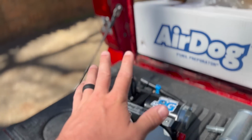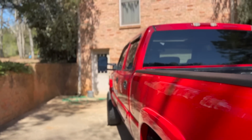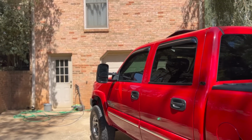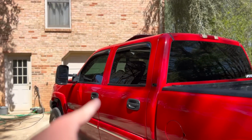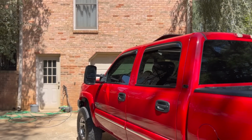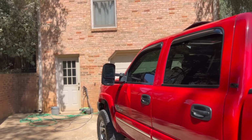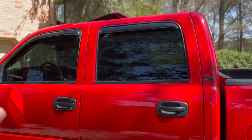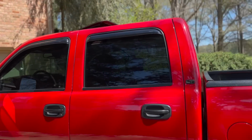Now, number two, the lift pump portion of this is going to pump your fuel from your fuel tank to your factory CP3. In stock form, you've got a CP3 sitting in the valley of the engine. It's drawing, or sucking, the fuel all the way from your fuel tank to your factory fuel filter and then on into your injectors. That's obviously pretty demanding, and over time they can become weak, they say around that 200,000 mile mark. Not only are we going to have much more filtration, we're also going to have our fuel pressurized to our CP3 so that we have optimum fuel pressure.